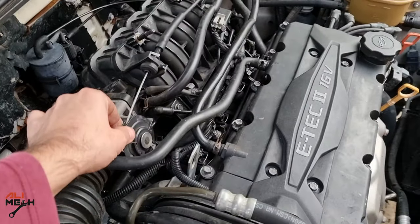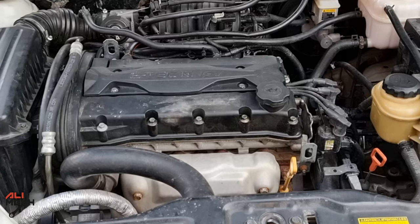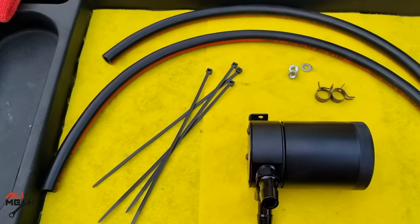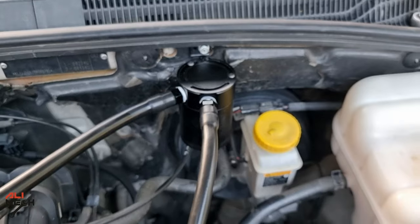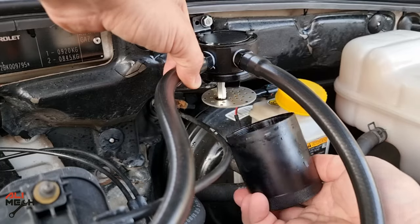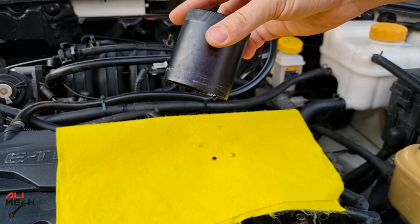The engine is warmed up now and has no lagging. After the test drive, I could feel the engine gain power. I won't have heavy carbon buildup again because since I installed the oil catch can, the intake manifold is dry and oil-free. I'll put a video in the description box showing how I installed the oil catch can and how much oil it catches, preventing it from burning and creating carbon buildup on the intake valves and piston head.